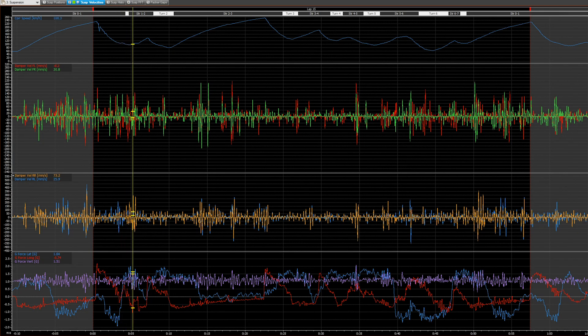In order to get really good velocity data from your damper potentiometers, that damper signal needs to be logged at quite a high frequency. Typically this logging frequency is between 250 and 1000 hertz, meaning the logger would be recording each position signal between 250 and 1000 times a second. Once you've logged the damper position data at a high enough frequency, the differentiation becomes smooth, giving you a relatively continuous velocity profile from each damper potentiometer fitted to the car.